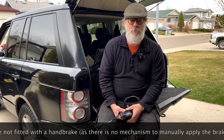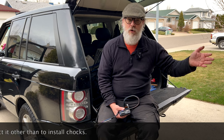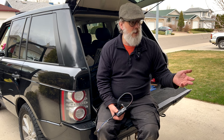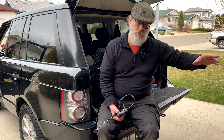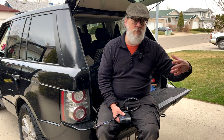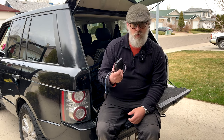I find this system very fickle and very difficult to set up. Multiple different types of trailers that weigh different amounts, carry more or less, have more or fewer axles, have more or less braking efficiency because of their design — and that continually has to be adjusted using these knobs and control systems. If you rent trailers, you're continually having to adjust it to get the right braking effort, which is not as easy as it seems. I don't like this system very much; I think it's far too finicky.